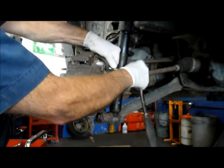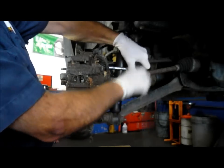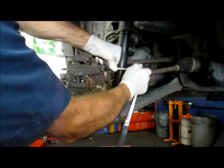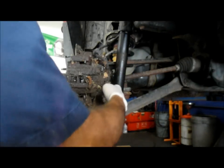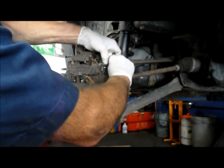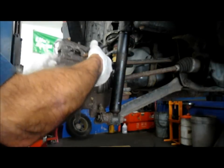You can come in through the back like you normally would, and as you can see you have a little bit of play so you can actually get it out without a problem. Now I'm just using this to pull these pins out. These are the two sliding slide pins and we're going to lubricate these before we put them back in, and take this caliper off and just relocate it up for now.